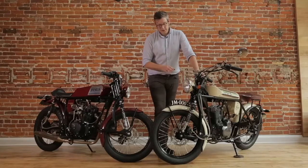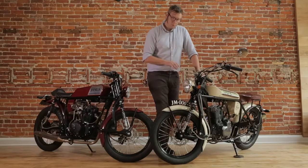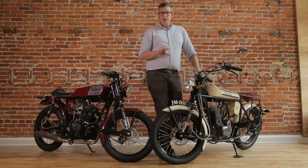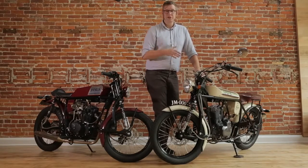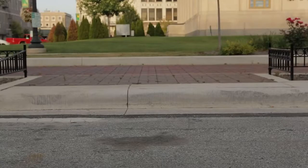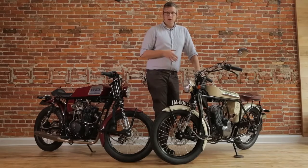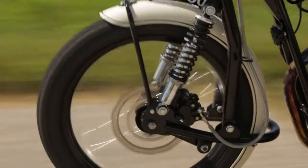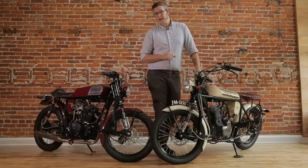Lastly, these are very strong for lateral forces and they have an inherent anti-dive quality. By that I mean, under braking forces, the front end of the bike does not dive. It does not reduce the wheelbase of the bike. It actually maintains a very consistent feel through braking and cornering, meaning you don't have a change in the way the bike feels under different riding characteristics, which is actually an amazing plus. It works really well for lateral loading, and that helps with use with the sidecar, which we'll give you more information on soon.